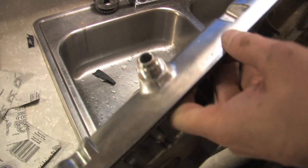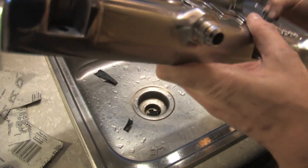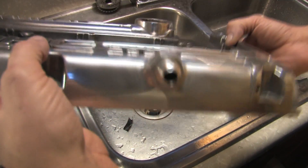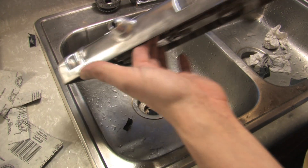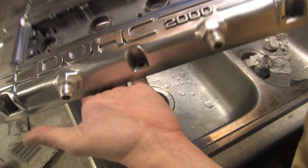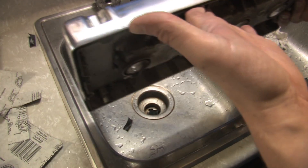Now those are prepared for polishing. That's what I've got on both sides. And I sanded down the front of it with 1500 grit because I intend to fully repolish that side in order to blend it right up to the radius.